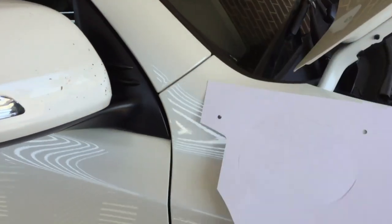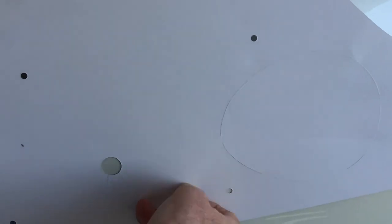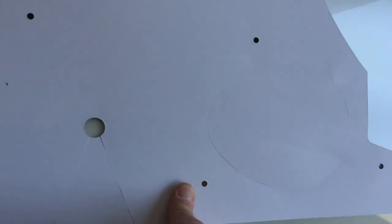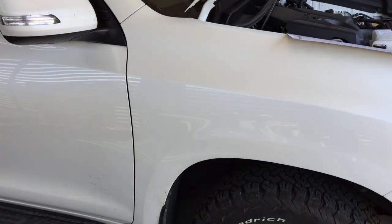I've got the template here. What I've seen one fellow do is put the template up the right way and instead of drilling a couple of massive holes, use an air saw to make it one big hole. I've seen some where they talk about using an 89mm hole saw and then opening the oval up after that. An air saw might be a little bit easier, and at the end of it I get to keep the air saw — whereas an 89mm hole saw has really limited use after this.